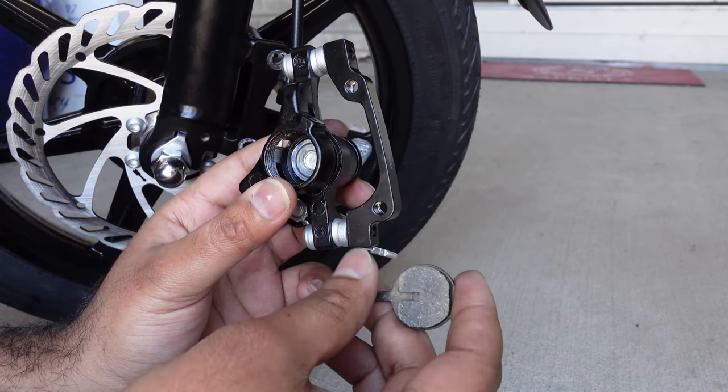About here — and now we're going to test this. To test it, we're going to lift the bike and then rotate the wheel and make sure that the wheel can rotate without any drag. It should be free to rotate because if it's touching too much on the pads it's not going to be able to rotate. It's rotating and then it stops with the brake. You might hear a little bit of noise which is pretty normal with this bike, but the main thing is you want to make sure it is not touching anything and the brake works. And that's your test.